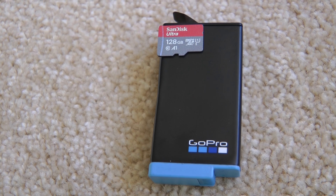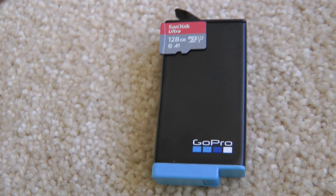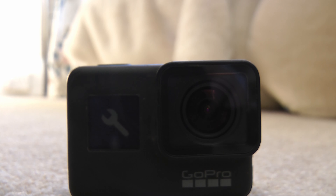I changed my SD card to a smaller SD card and that seemed to fix the problem. I'm not trying to say don't buy big SD cards — do buy big SD cards if you need them, but only make sure they're really fast. This will ensure you don't get any green lines or glitches during your footage.